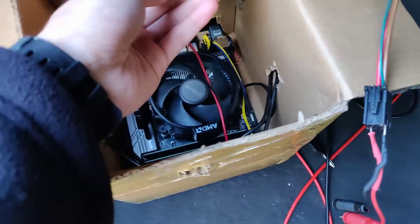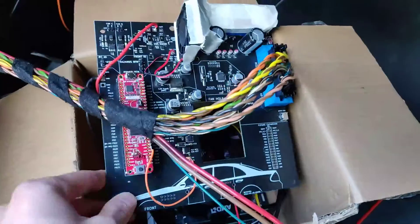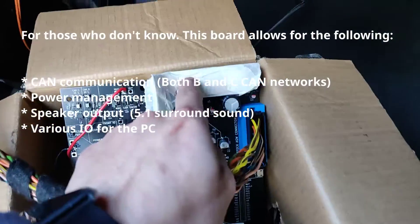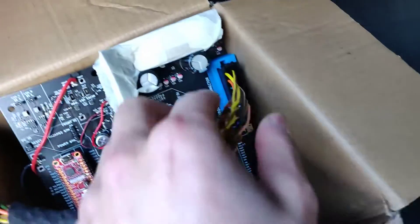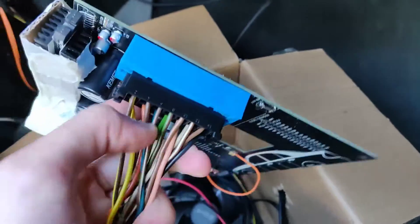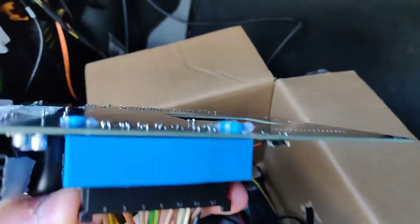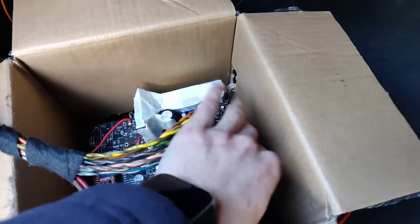For those who tuned in to my live stream on Wednesday, I've assembled this board now. I've basically got my TDA amplifiers here, which are being actively cooled by this fan when the system is running. And I've 3D printed a connector so that I can connect the stock speaker harness to it. That's currently glued into the bottom of the board, but we can fix that later on.